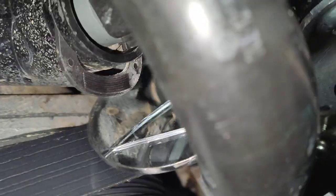My guess is that it puddles and then gets drippy down there, and then the water pump and the belt take it over and spread it everywhere. Because I cannot see moisture at the temp sensor, which was my main suspect — this guy stayed dry.